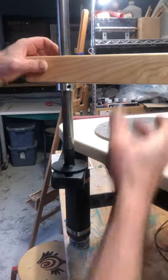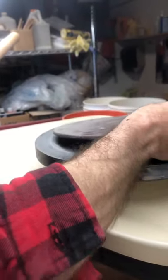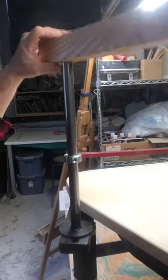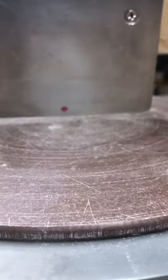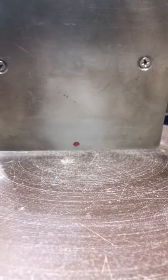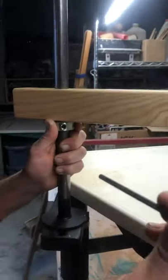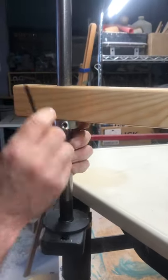The next thing is you want to take this back off and use your intended bat for actual use, and then put this back on. Now see, this is almost set perfect — see that height? You might want to be just a touch lower, but you don't want to be scraping the bat hard; you want to be floating just a touch above it. So that's about perfect. Take the wrench provided and tighten this down. Done with that part.